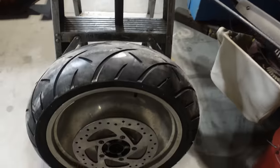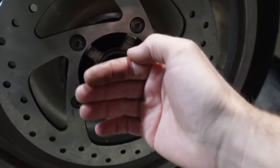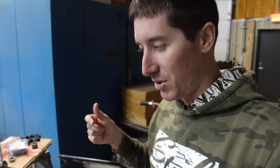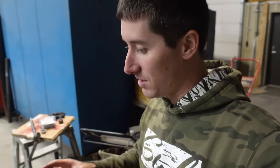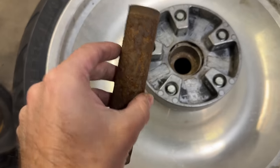Mine on the other hand — I thought we were out of luck again. Marco and I tried to get those wheel bearings out, beating on them — they're shot. We had the new ones right there. Marco has a blind bearing puller that expands inside, but there's no gap to get a drift through and there's a spacer in there, so you can't catch the edge of the bearing. We had zero luck. We tried the blind bearing puller with a slide hammer and got nowhere. We even tried pushing it out from the opposite side with his hydraulic press and it pushed the tool right out, taking a bunch of material with it. This thing looks absolutely rough — no wonder it was impossible to get apart.